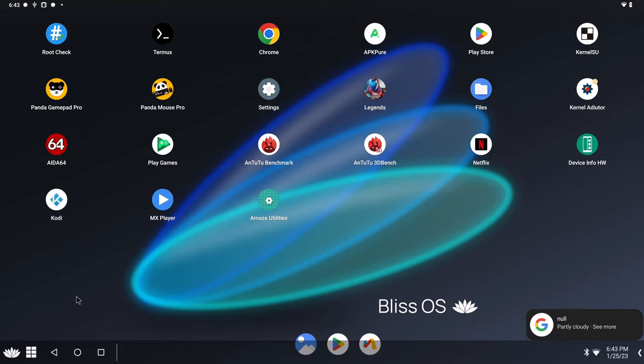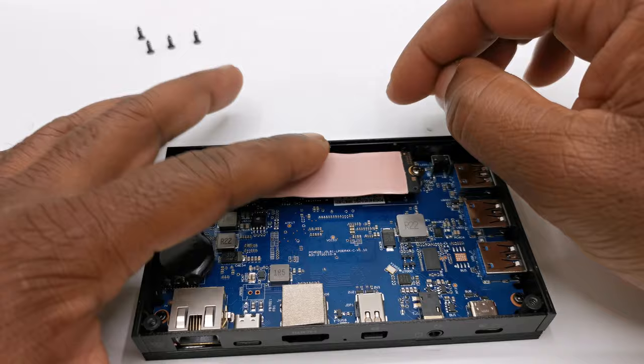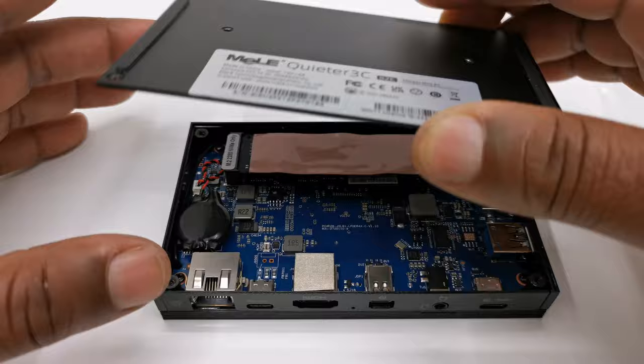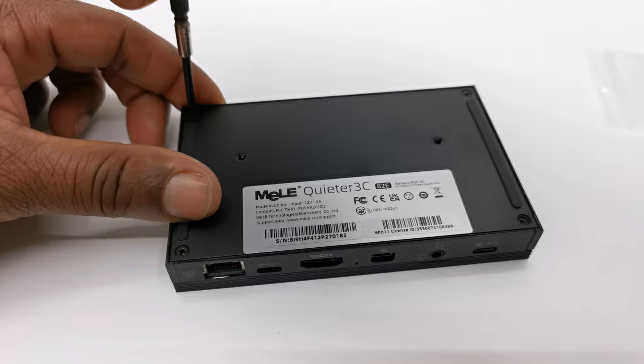So using a Samsung 980 256GB M.2 SSD installed into its 2280 M.2 expandable storage facility, I successfully installed the latest version by importing and registering the required EFI keys from the installation disk to bypass the secure boot feature in its BIOS. Without doing this, you cannot install Android x86. For more information and a video tutorial, see the link in the description below this video.